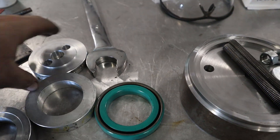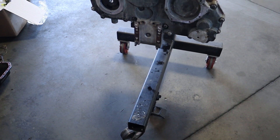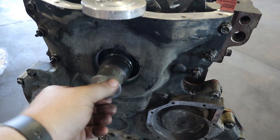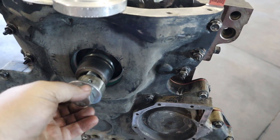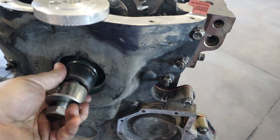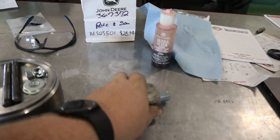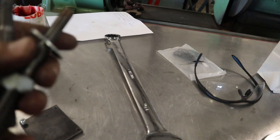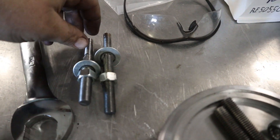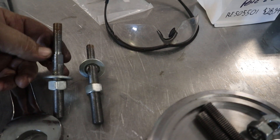I've got a couple of pieces on it. It depends on what kind of crank you've got. This one is a single-bolt front — sometimes there's a two-bolt. I just use a bushing as a washer. So if you've got a two-bolt, I've got this that I made. This is just from some metric all-thread, and for ease of use I milled a wrench flat on it, and then turned this down to a smaller size.